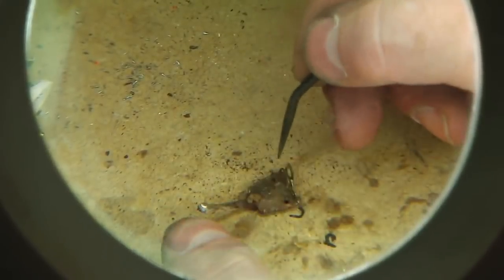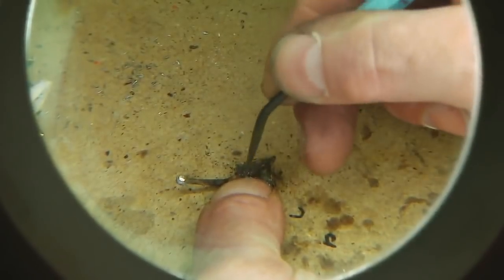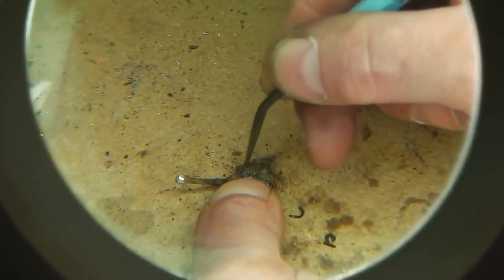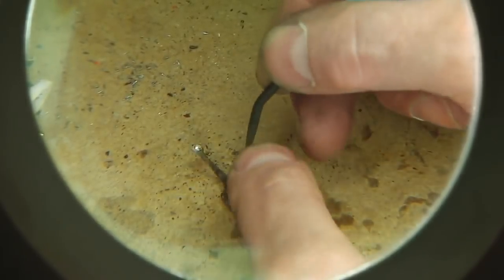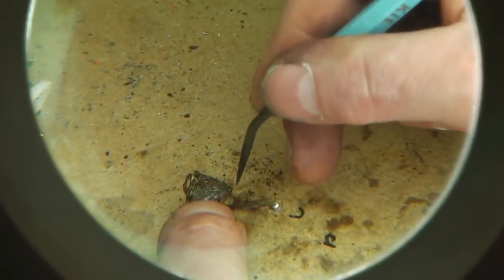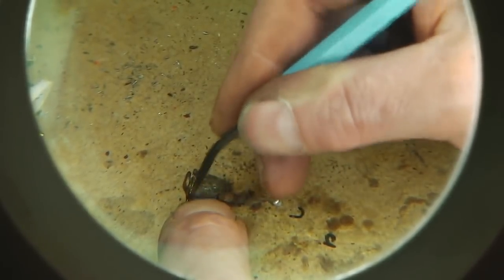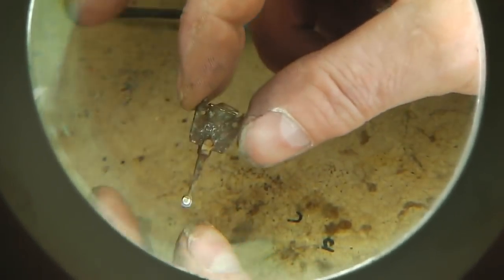Before anyone wanted to point that out, this is actually quite badly pitted. It's actually eaten into it. The file won't do it, it's pitted, so I'm digging it out. Whole thing's pretty bad, to be fair. And these little bits of iron can fall inside the working, so this would be an unreliable unit, I think. That's cleaned up, I'm going to blow some air through that.